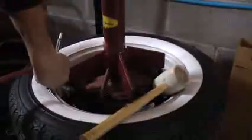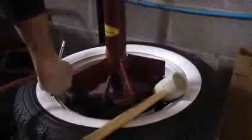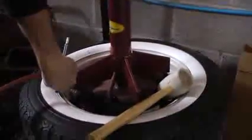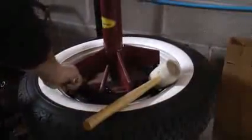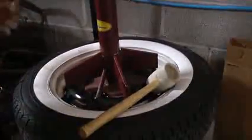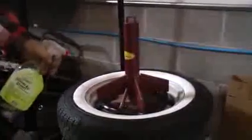And you know, your front tires, I like, again, like 20 pounds or so. Rear tires like 25. I know that's even a little more than what the manual states, but bug tires really don't get that much air in them. So I know most of these tires today, they want like over 35 pounds, but not for a bug.